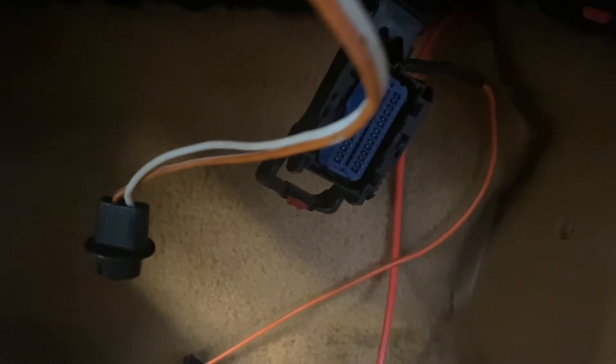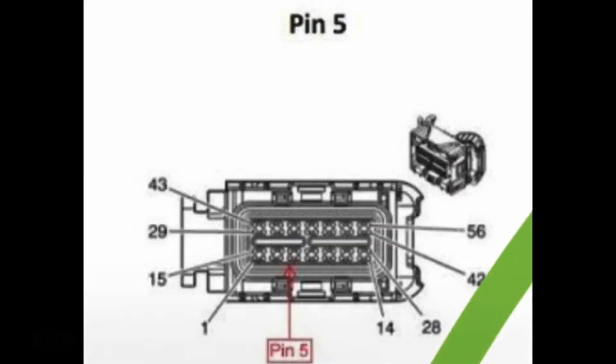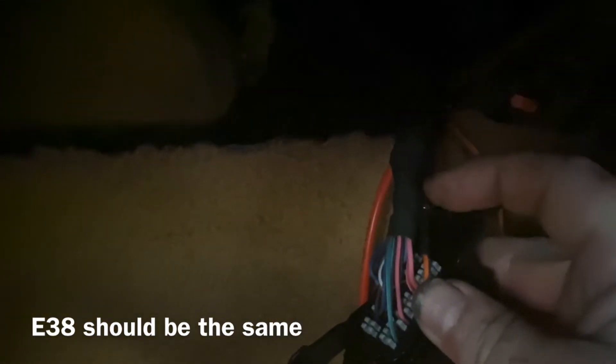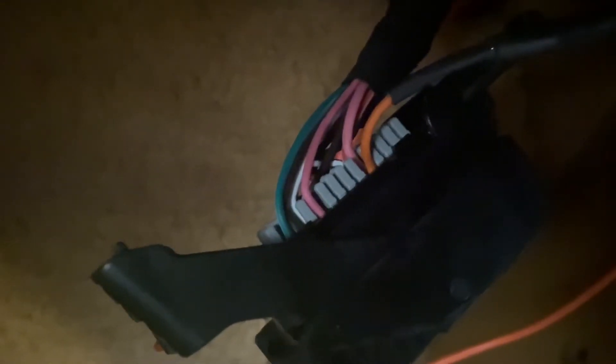So this is my output from the E85 sensor. I essentially ran it through the console and then through the firewall and over to the engine bay. This is the output that goes to your pinout, and it goes on the blue plug for an E67. You'll have to check your ECM to find the exact pinout for yours. If I turn this around, there's a zip tie here — you typically want to take that off — and there's the wire right here. You can see that is number five, so it's basically C number five pinout.